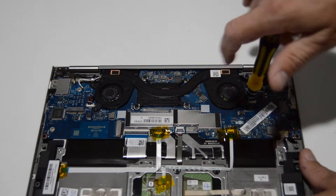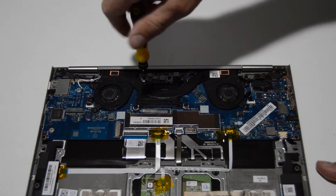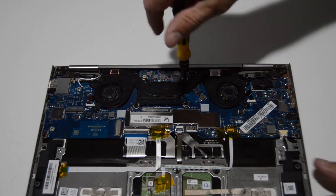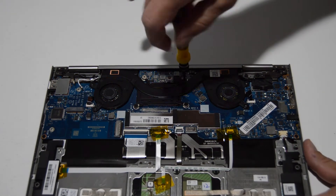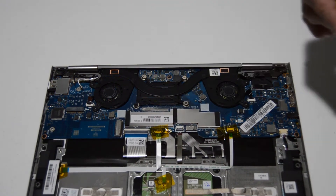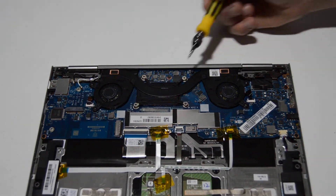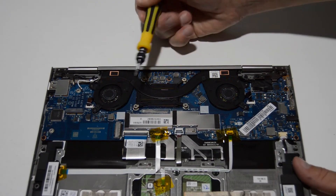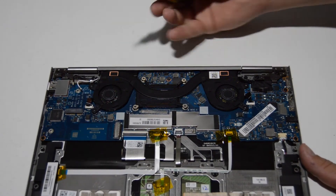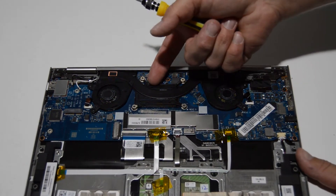What they've done is add a lot of tape on the top and bottom so the fan and heat sink stick together and seal the air. This means you can't replace a single fan without removing the heat sink and reinstalling with new thermal paste — it would be more convenient otherwise, but that's not how this model works. On the heat sink, the screws are labeled one through four. When you re-tighten the heat sink down with new thermal paste, tighten in the stamped order — it usually goes in a Z or N pattern to spread the thermal paste evenly.